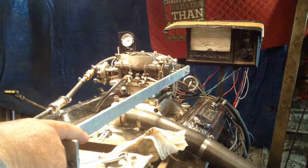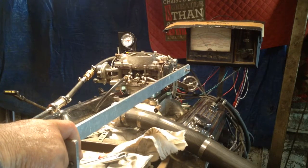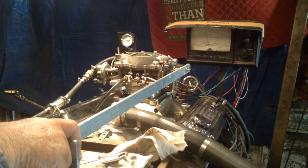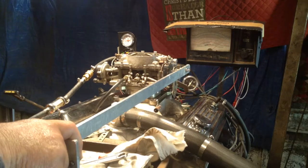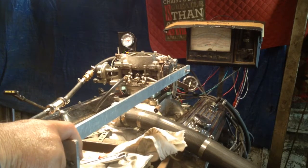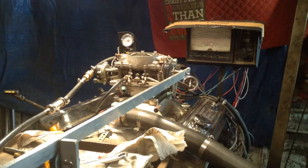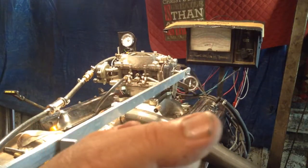If I start it up and change the fuel level it'll go ahead and quit. See it? Terrible flooding condition — terrible flooding. Okay, now that the fuel level has changed — do you see it? It smooths right out. That needle is worn out and it's dropping out of that hole, hitting on the side, not sealing it up.